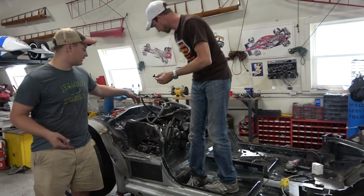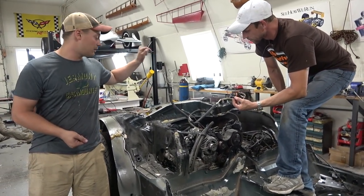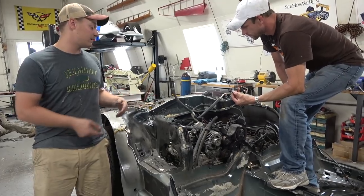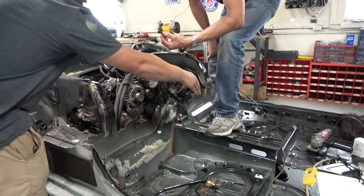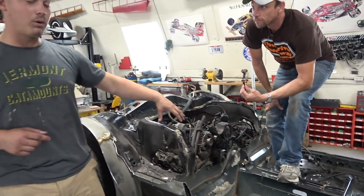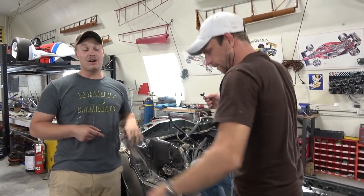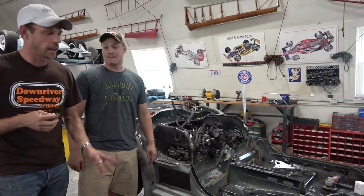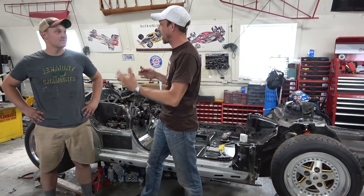On the back today, we cut out a big section of metal and cleaned up the top of the engine. We're getting ready to take the bolts that connect the engine to the transmission off and pull the transmission forward. To do that, we're going to need to cut this section of metal out of the floorboards — not a huge problem because we need that room to fit that monstrous Honda V12 in there anyway. A lot of what has been removed has made this chassis structurally a disaster. You cannot drive this thing the way it is. There will have to be a lot added.